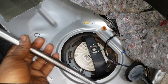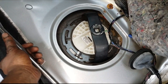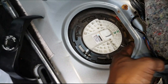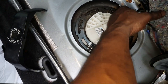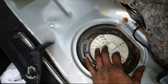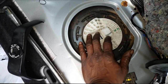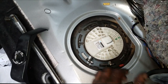Before you yank all this off — I'm not in the shop so I'm unable to do this part — you really should take an air blower and blow the area clean, because you don't want any trash to end up in the tank or around the seal area. If you are in the shop, spend a little time cleaning the surrounding areas up around the pump.